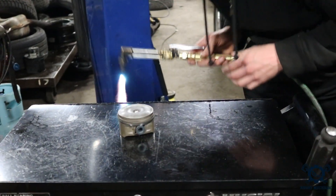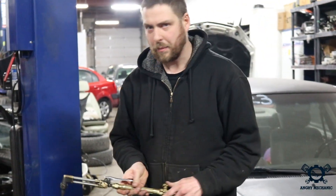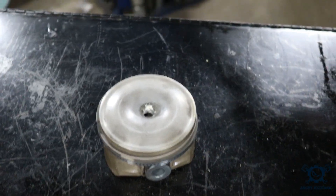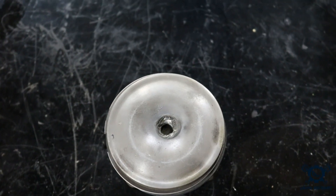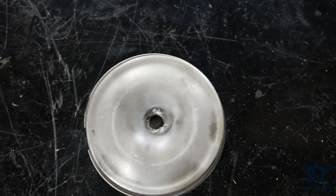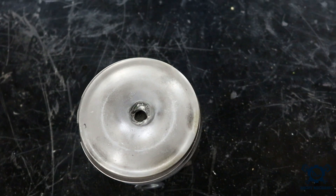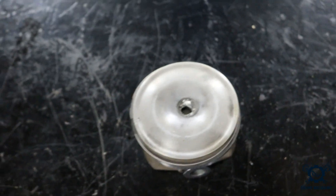There we go, that's all the way through. So there you have it — we've melted a piston. This is an extreme scenario; most automotive pistons are built very robust, but they're not really designed to handle running at wide open throttle for an extended period of time with a lean mixture. Obviously the forces in your engine are far greater than what this torch can produce, and this would happen in your car a lot quicker. It just goes to show you how important tuning is and maintaining the correct air fuel ratio. That's what happens to your pistons when you run too lean. Thanks for watching.